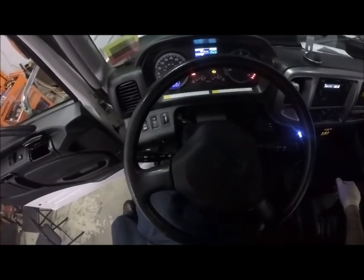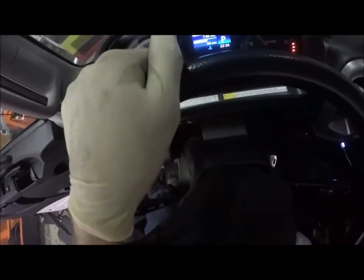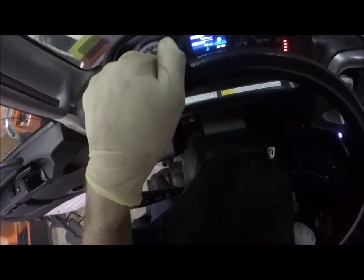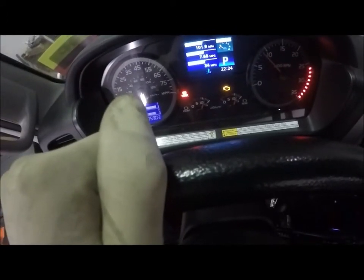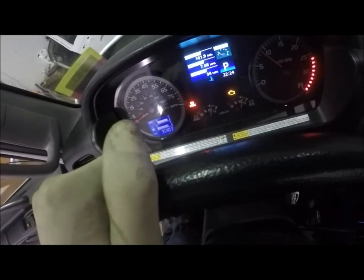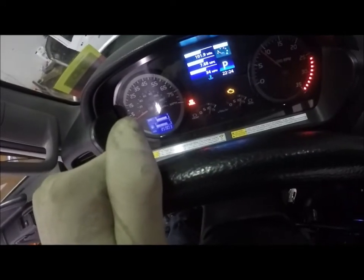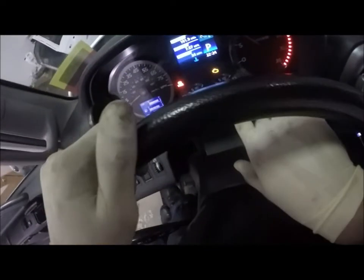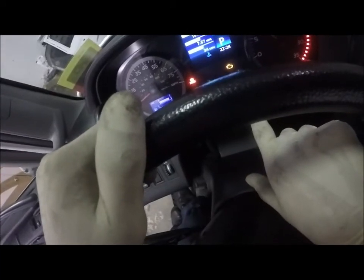All right, so we're up and running. The AC feels good. We're at about 110. Just looking for any drop in air pressure. Just kind of doing a bleed down test. Compressor hasn't kicked in yet. Needle's at 110. And that's running off of my auxiliary tank, which is my rear tank. So I don't see anything. It's not moving at all.